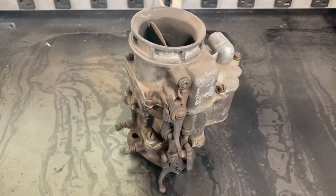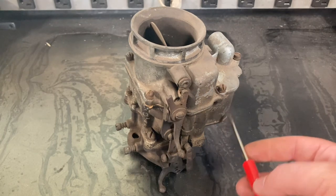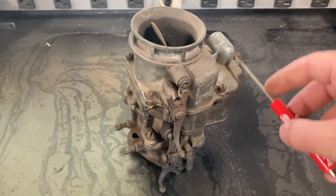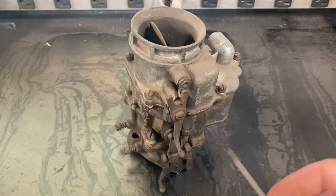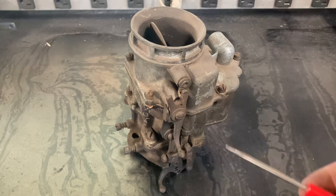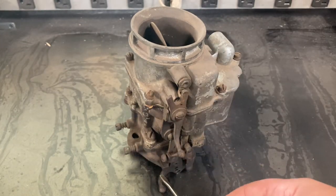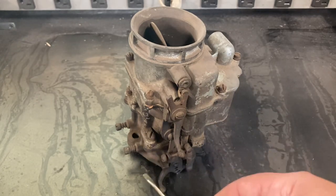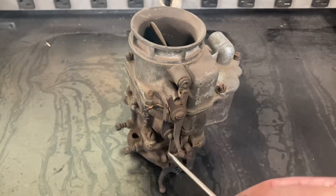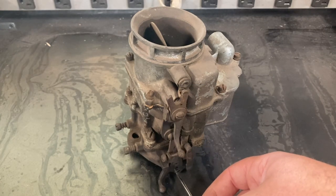So a quick summary of what we have so far: you have a fuel bowl filled with fuel, controlled by a float and a valve. You have metering jets that control how much fuel can be used at once — those are interchangeable. You have an idle circuit that works independently of your throttle, which maintains engine speed at idle to keep it from stalling. You have throttle control through your butterflies.